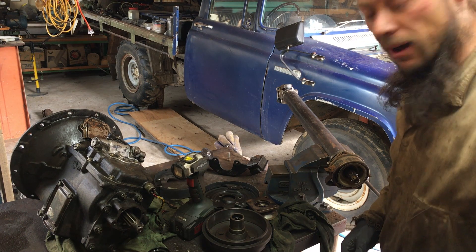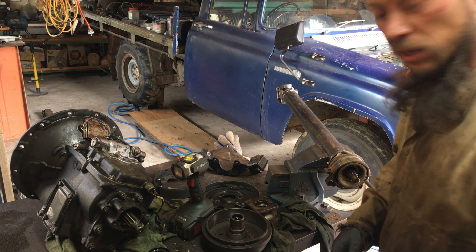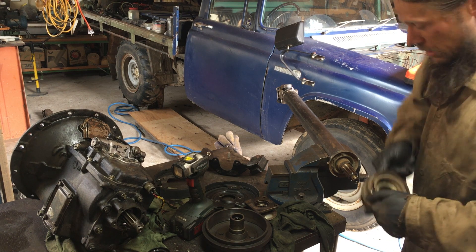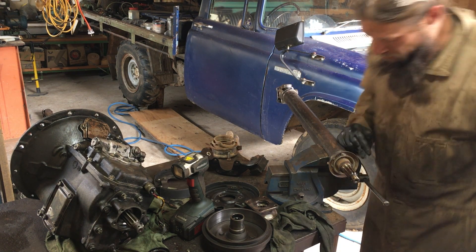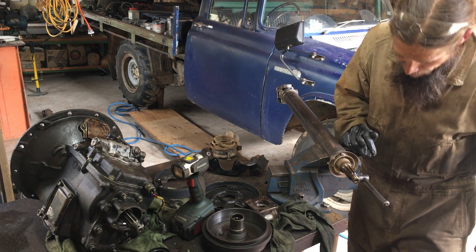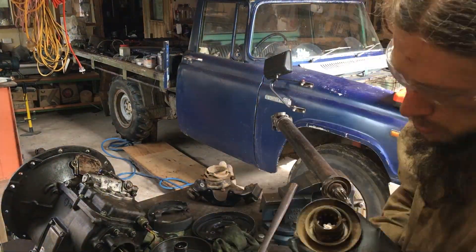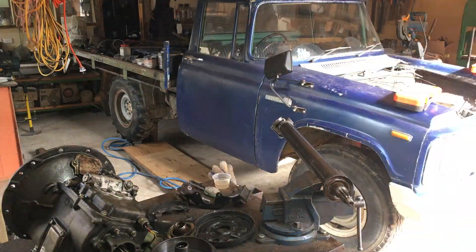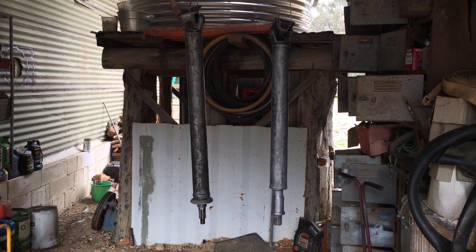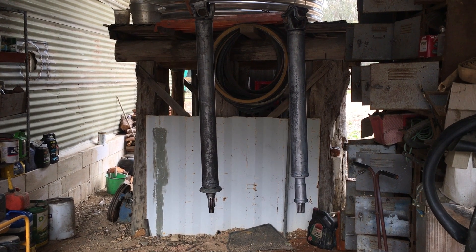That was way harder than I was hoping. The brass drift and the hammer didn't work. The gas didn't work with the brass drift and the hammer. Had to get that whopping great puller to do it. And that's the center bearing off. It's not that bad, but there's just a little bit of residue and rust in there — doesn't take much. I've given the tail shafts a quick scrub down with the angle grinder and put a bit of phosphoric acid on them — just a rough coat to stop the rust going any further.